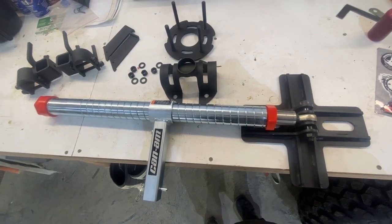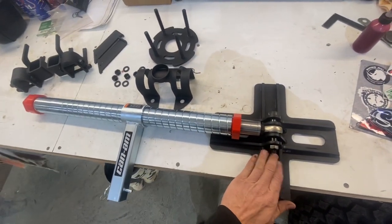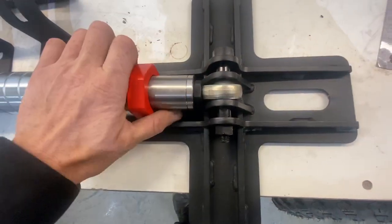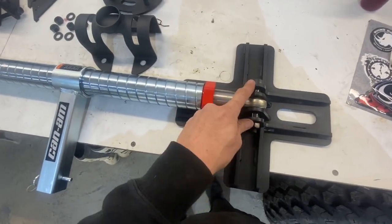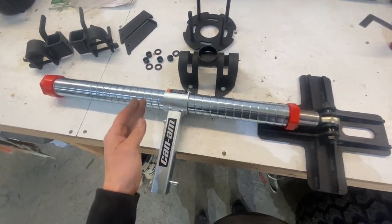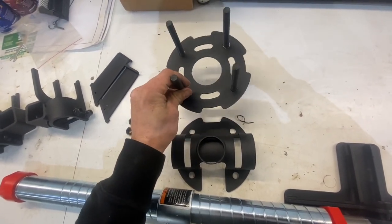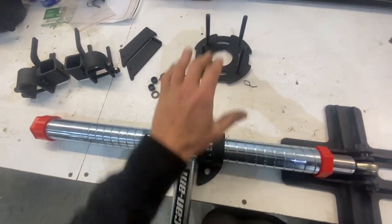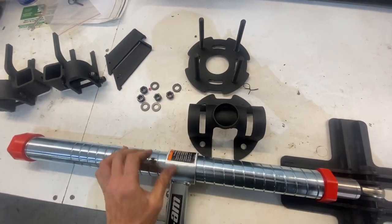There's another cool Can-Am accessory: a screw jack. It doesn't come like this — you have to put the foot on. This little heim joint just screws into the end; put the bolt through, red Loctite to put that in. Put this on — you don't want that ever to come loose. You have your rod here; it's adjustable where your pickup area is. The way they advise to mount it, especially if it goes through a spare wheel, this goes over the jack like that, goes back on, and you tighten it all to the spare tire.